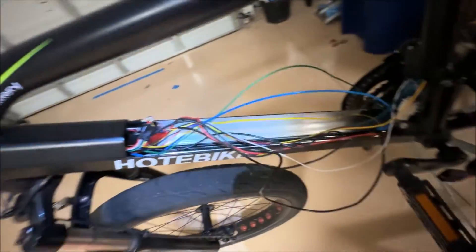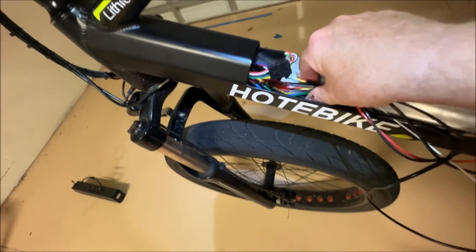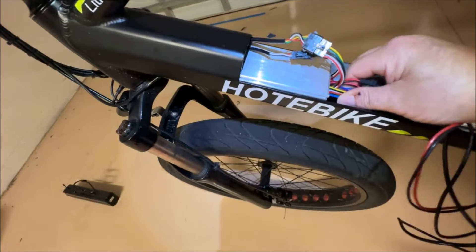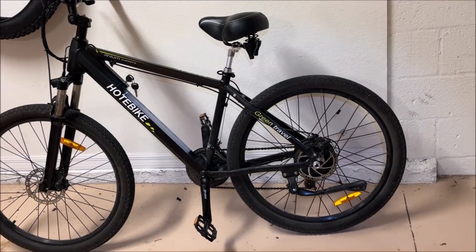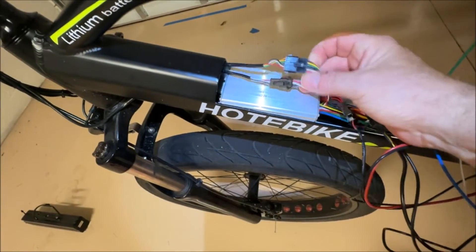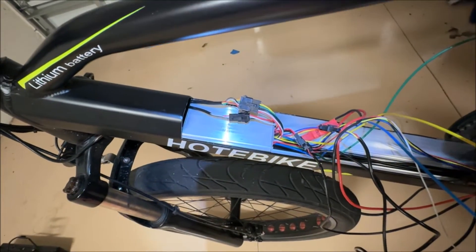I'm not going to take this one apart any further. On the main bike, I've already got the connector out and the controller is tucked away in here — just pull that out and there she is. One of the nice things about a hot e-bike is that the controller is hidden and the bike is very well constructed. On the mountain bike version it doesn't even look like an e-bike. From here it's easy — you just take these connectors off, unplug everything down here, drop the new controller in, and put it back in place.